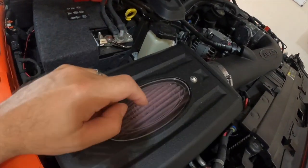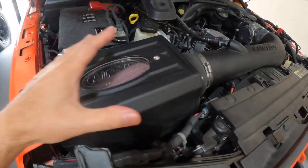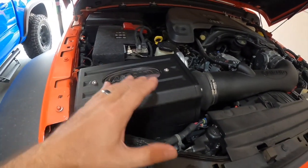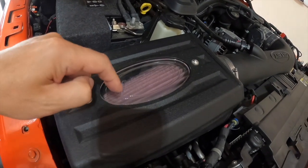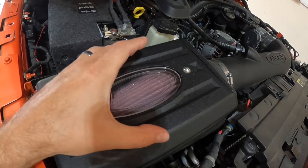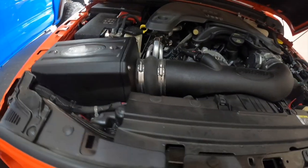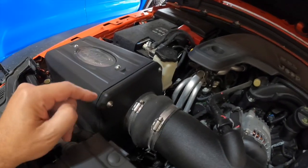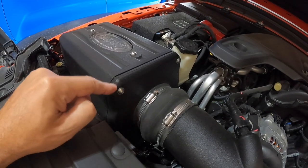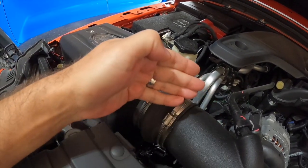You know, the air filter is right there, obviously, this pink or red thing that you can see. But notice, there is no lid or anything on this. You just have this little window, which does screw in. But obviously, you're not going to fit this massive filter through that window. So, the only way that you can replace it is to unscrew these 4 bolts, or screws, 2 up here and 2 down there, and then pull this cover off.